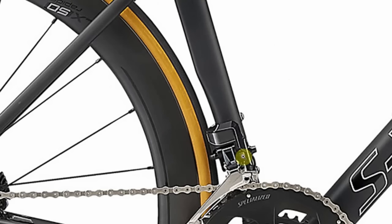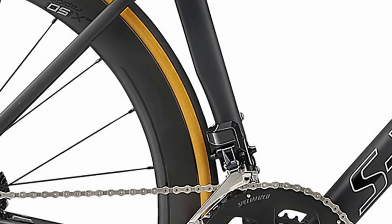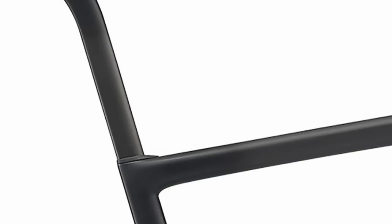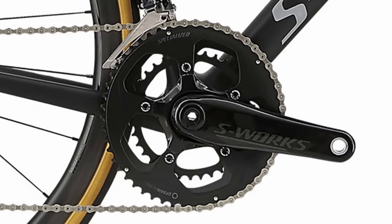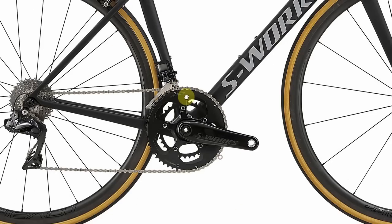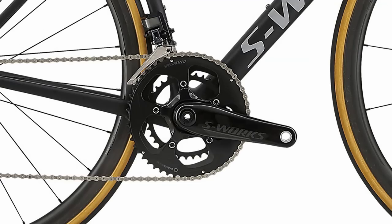The other thing you notice quite quickly is the seat tube — on the rim brake version the rear wheel is closer to it, and they've obviously had to change that shape accordingly. The seat stays are pretty much exactly the same, and I can't see any difference in the seat post either. The only other thing I noticed — and it may be the camera lens or a different size photographed — is the crank position. If you line up the front and then look at the position of the bottom bracket, it looks to me like the disc version has gone back a little bit. But that could just be the photography, and according to the geometry measurements they're exactly the same.